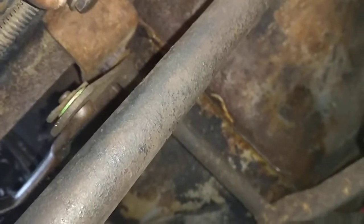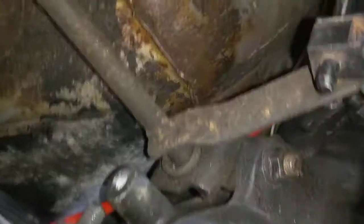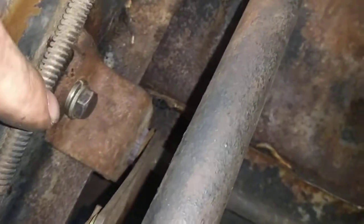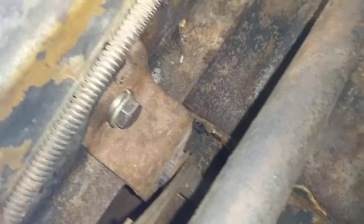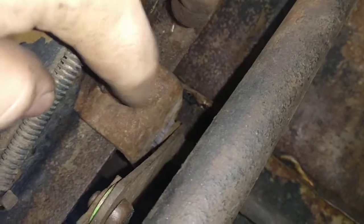The way I got the Z-bracket in here — there's a little piece that you have to bolt onto the trans right there. You want to bolt it on as such, and then when you're about to get this Z-bracket assembly up in here, you just got to kind of shove it up and in. The first end needs to go right in there, then you bring this end up, and you will have like two small holes and a big hole. The big hole is the recess for the little hook on this bracket. The smaller hole just above that is threaded — that's where the bolt is sitting.